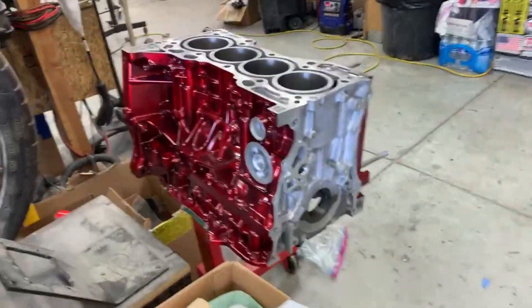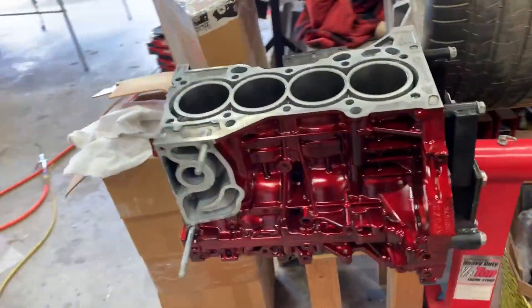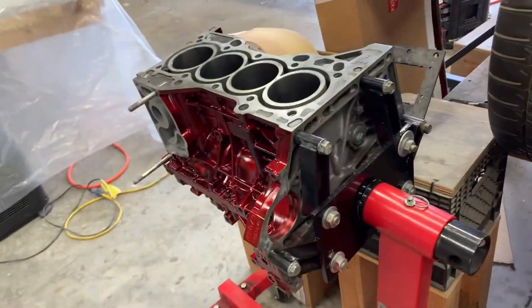So what I've decided to do — my red MR2, that's my personal MR2 — I blew the motor, cracked the block, and broke a couple of ring lands a few months ago. And I've been building a new motor, which is right over here. I just got it all sprayed up. It's bored out just a little bit, just to clean it up. And I got some forged internals for it and everything.